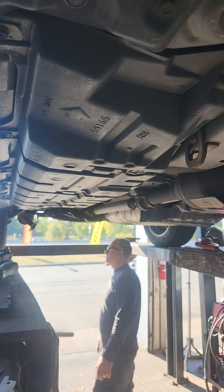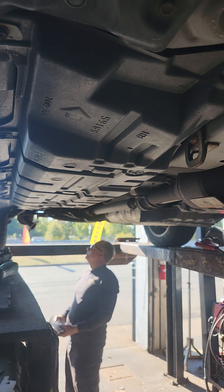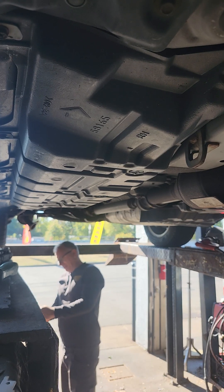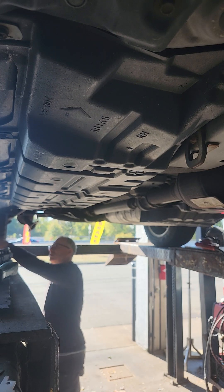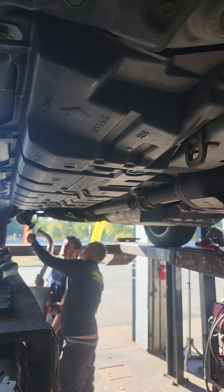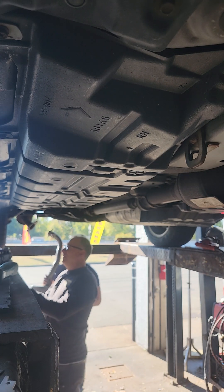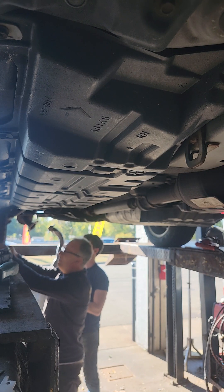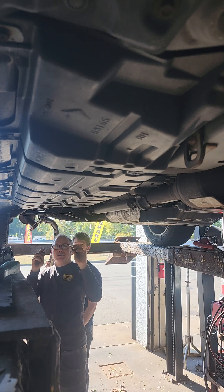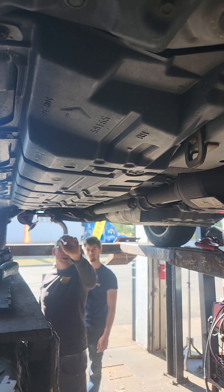I don't like aftermarket spring bolts, but this is what I've got to deal with. If I don't have the right configuration spring bolts, I will reuse the old ones if they're still in good shape. These threads actually fit. Not that I trust anything aftermarket for quality of fitting. I'm matching the threads — I was just teaching Sierra how to tell what bolts are without looking them up on a chart. I've been doing this so long. These are 10 millimeter, 1.50.